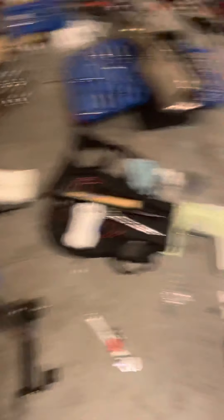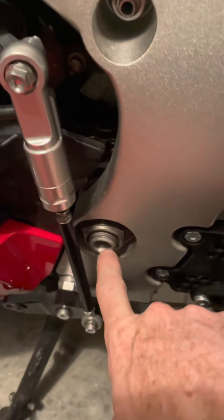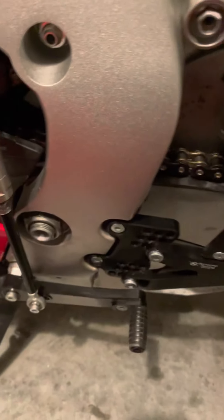Let's talk about why I took the swing arm off — let's go take a look. Here's why: I kept hearing a grinding sound and couldn't figure out why. This is the part that attaches to the frame, and the chain was starting to literally dig into it. I could see grooves or channels being created, which is very dangerous because eventually it will cut in far enough to break off — potentially going through the pivot pin, which is the giant thing that holds your swing arm to the bike. Doing what I do, anything over 80 miles per hour with that failing is potentially deadly.